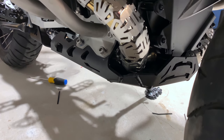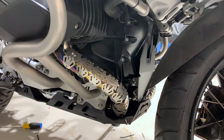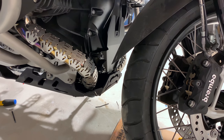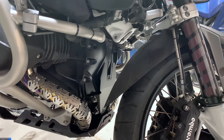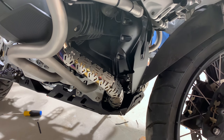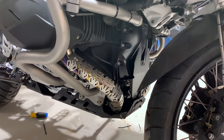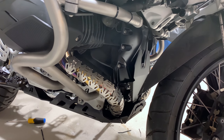So these obviously protect down into the skid plate just a little bit, right at the tippy top of the headers. On the scale of do you need these — the way I ride off-road behind people with lots of gravel and rocks, lots of rocks will hit the headers. You'll hear ping, ping, ping — that's just rocks hitting the headers. On my last two GSAs, the exhaust headers were dented and dimpled pretty bad. There were no cracks, no rusting, no damage as far as I could see — maybe over a few years that's a different story. But if you're going to be off-road, and only if you're going to be off-road most likely, the header guards are really nice to have.